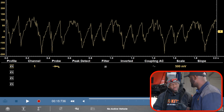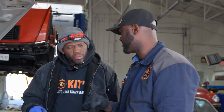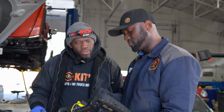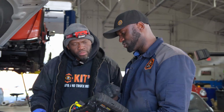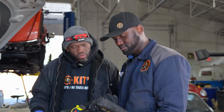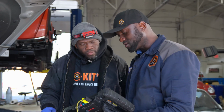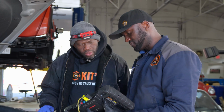Remember what we did yesterday when we were doing the Corvette? We did a relative compression test on the Corvette yesterday. Remember we had peaks and valleys across. Yeah, all of them were the same across the screen. But right now, as you can see, we have only 2 good ones. But this one over here is a problem.